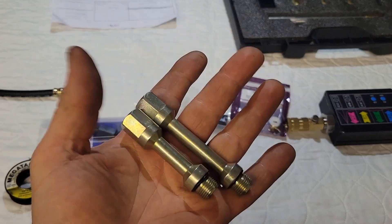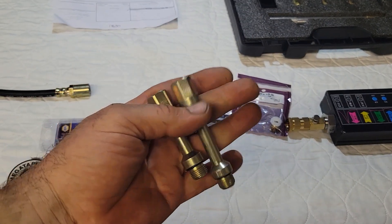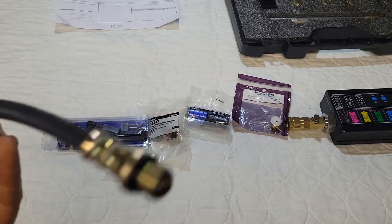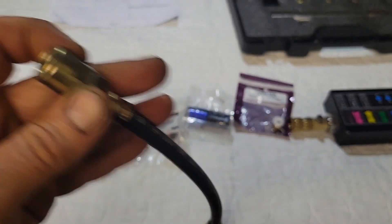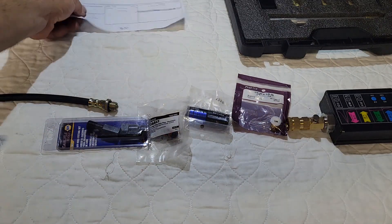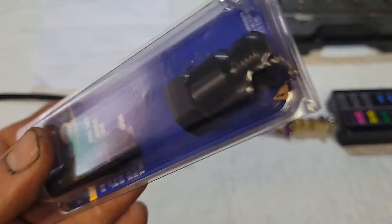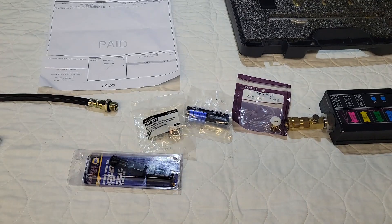They say keep it as short as possible. There's a very short one and a long one — you could double them up if you have to, and that's still better than going to the hose. But if you do have to go to the hose, this is brake hose with very heavy fittings on the end, and that's the M12 on this end — that's where we thread in from here. At Napa it was $11.44 for these two. That's already cheaper than the fittings I was looking at on Amazon, and it would have taken me two fittings to make that. Napa comes through in the end.